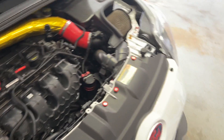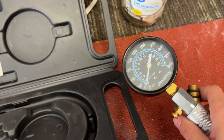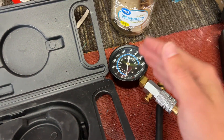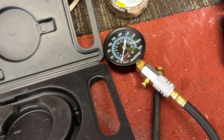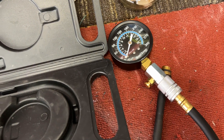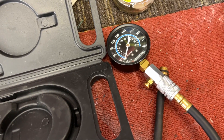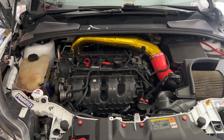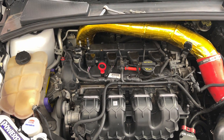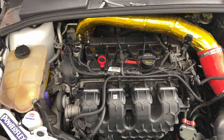You may not see that exact number on this gauge just because it may not be accurate. What we're really looking for is one cylinder that's quite a bit lower than the others. We want a consistent number across all four cylinders — whether your car is a V6, I4, V8, or whatever. We'll be able to tell pretty easily if one cylinder is lower than the others.